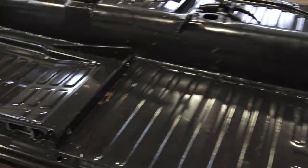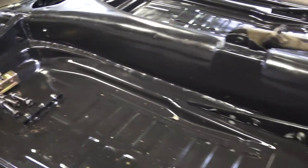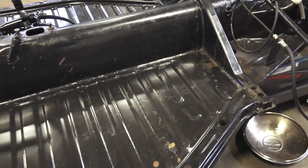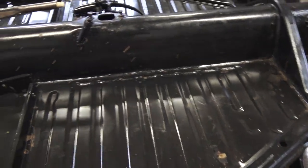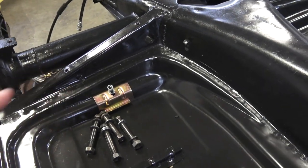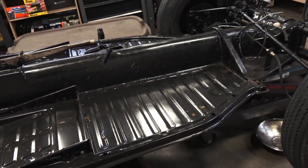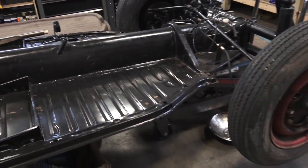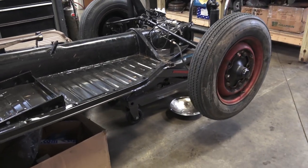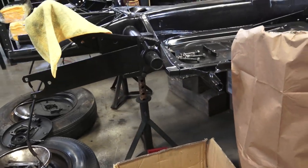The fitment was excellent and the welding was really nice along the seam. I have floor pan installation videos on my website. We also welded up the tunnel here because it was all rotted out as well. The fitment is really, really nice — and it's always great to do floor pans when you've got a nice open area and you can work like a gentleman. We have this thing jacked up on a dolly with some jacks, so it's always good to work like this.